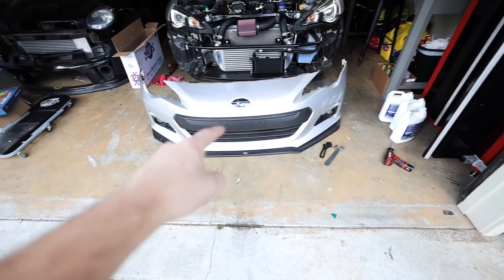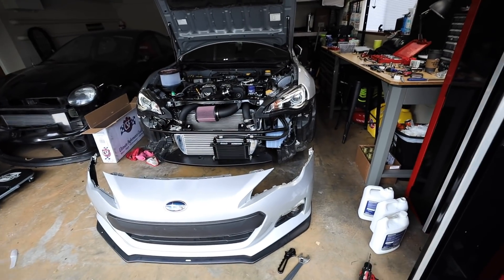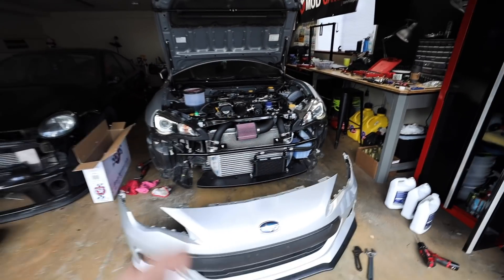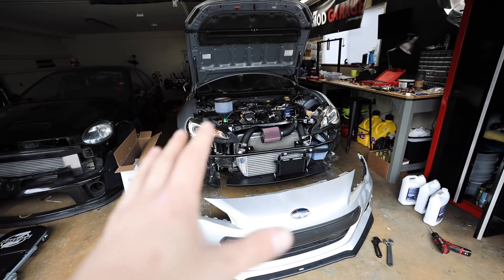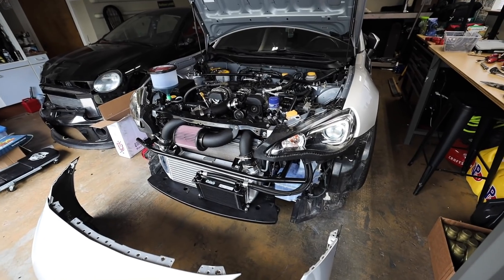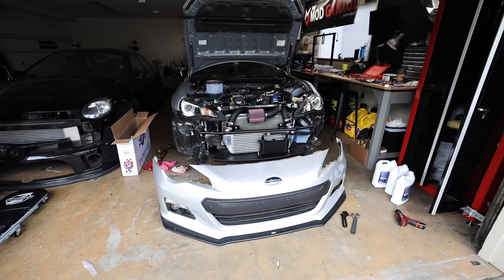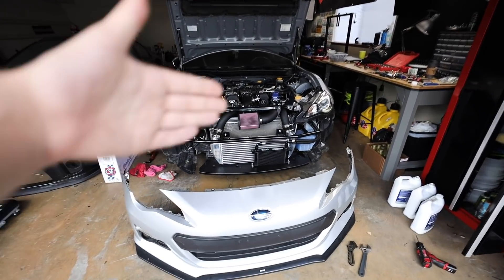A couple small issues to address: the lower grill has to be cut out — we don't have an option, it sticks out too far on the backside and will hit the oil cooler. I need to get a Y-fitting adapter for the oil pressure sensor location so I can have both the AEM and OEM sensors in there. The head unit and clock aren't working — probably tapped into a fuse — I can easily fix that. The AEM air fuel ratio sensor is just busted. I have one in the STI that I spliced together when I had this issue last time, so we'll transfer that one over. The car is running — we're burping it and getting all the air out.